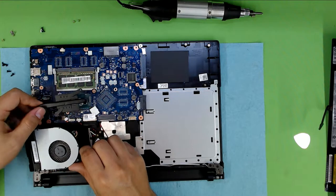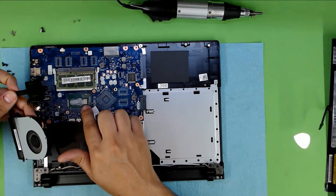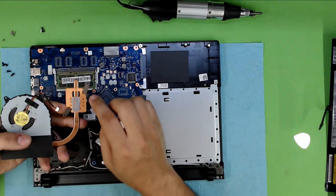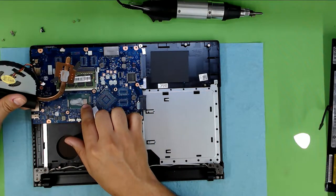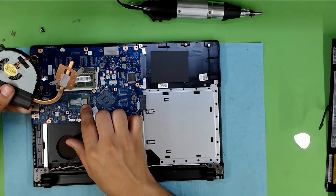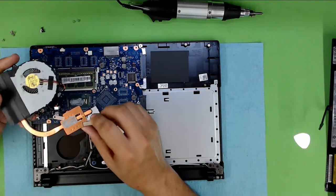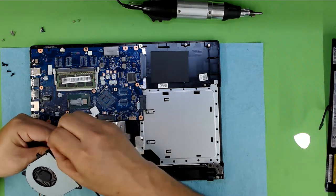As you can see on this model, they really messed up — they did not put thermal paste right over the second part of the CPU, and that's why it really overheats. They left it blank; I have no idea why. The second die in here does the graphical work, so this was either done intentionally or they just missed a thermal pad in there.